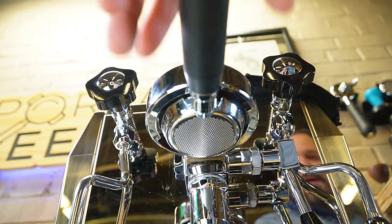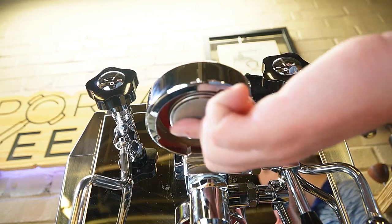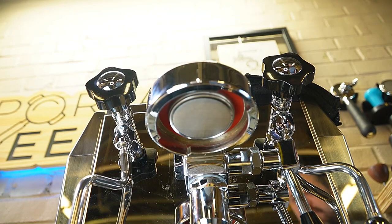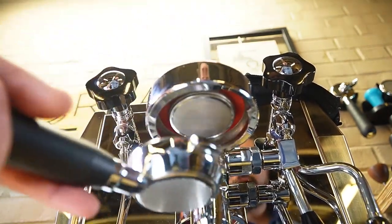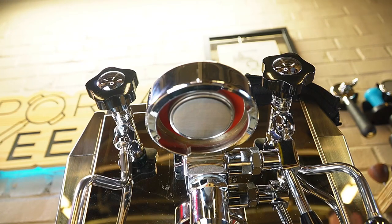It's as simple as that. I recommend picking up an IMS shower screen — very inexpensive — and also a silicone gasket. It is night and day difference for having a nice smooth lock of your portafilter, and they're only about eight bucks. I recommend doing this deep clean twice a year. I've been pulling quite a few shots on this machine lately and I'm kind of surprised at how clean it is inside. I do recommend doing a back flush a couple of times a week. Daily is recommended just with water, but I don't recommend using a cleaning detergent daily or even weekly, as I seem to have more issues with machines that use too much cleaning detergent.